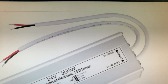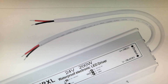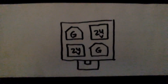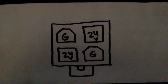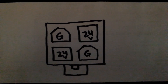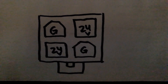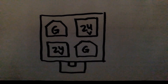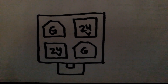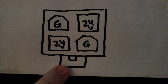There are two cables coming out of the output on the adapter, and each one has two cables, which is perfect because you just wire them — no splicing needed. Here is the wiring diagram. The square pins on the four-pin CPU connector are 24 volts and go to the red cables on the adapter. The triangular pins are both ground and go to the black cables on the adapter. It's very easy to tell — squares are 24-volt positive, triangles are ground. And here is the clip on the bottom that you press to pull the cable out.